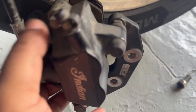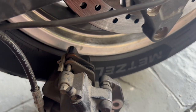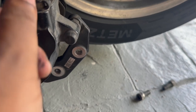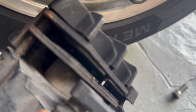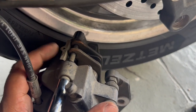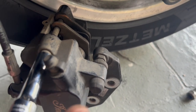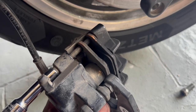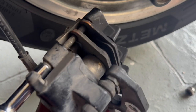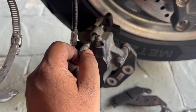To get these old brake pads out, there's a retaining pin here. It's an 8mm socket — let me just make sure. Yep, 8mm socket. Just remove this retaining pin and you should be able to pull the brake pads out. There's also a spring-loaded clip underneath the brake pads, so while you're taking it out just keep your hand here so it doesn't fly out when you remove the retaining pin. Also pay attention to how the spring-loaded clip is fitted — the orientation — so when you put it back there's no confusion.